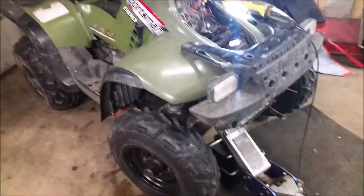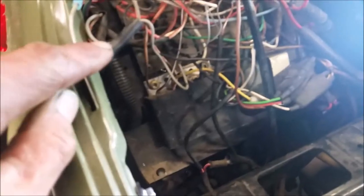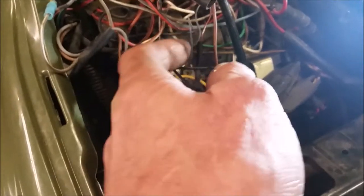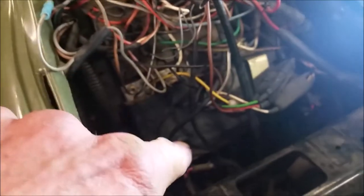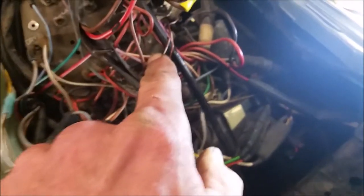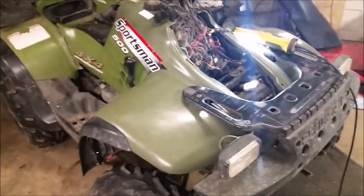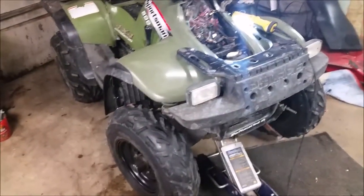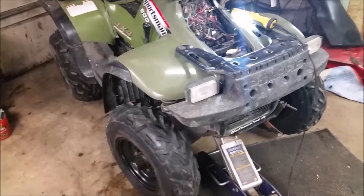Going back to your wiring: you've got your gray and gray-and-white wires coming in — the gray goes to the two grays that run down to the magnetic coils — and then you've got your brown and white, which is your ground. Just hook that right into the ground. A lot of times it's a ground issue, even on the newer ones. Give that a shot. Hope this helped — it helped me out. I can finally put my plow back on my four-wheeler and do some plowing. It's Wisconsin, it's December, and we're going to get snow in a week.